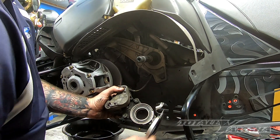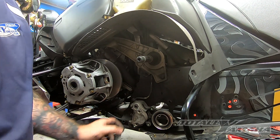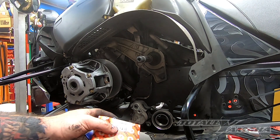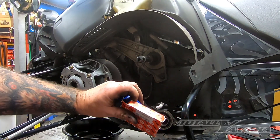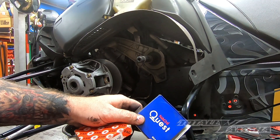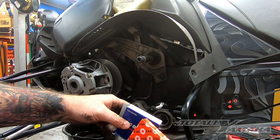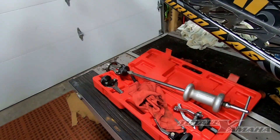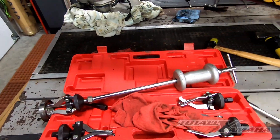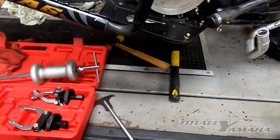Got the new seal for the back side. Once we get the shaft ready, we'll show you how we're going to put that together. I use an FAG bearing on this side, 6009. And on the other side, I used a Nachi bearing, which is basically a 6009 C3 — it doesn't have a seal on either side. This is my slide hammer to pull the bearings — you can get this at Harbor Freight. This is a tool for pulling seals.